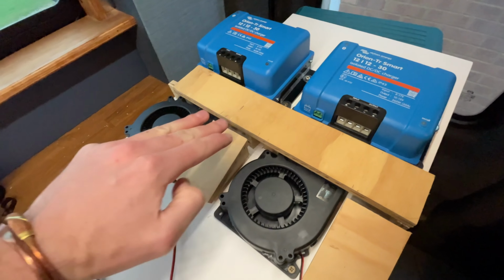You can buy individual studs or posts, but they were about £8 for a stud, and then the protective cover for the exposed terminal was another £8, about £16-17 per connection, and I needed to do four of them. Instead I bought mega fuse holders, which have an M8 stud. I'm just going to put a 100 amp fuse in the middle and use 50mm on one side, and then the two 16mm coming out the other side. The actual fuse isn't particularly important because I've got it fused at the source and it's going to be fused in these two lines. I'm just going to use the mega fuse holder as effectively a small bus bar, because this was £6 versus £16-17 to do it correctly.